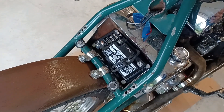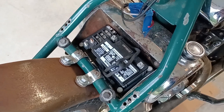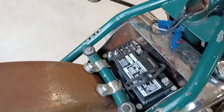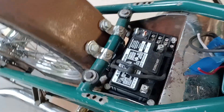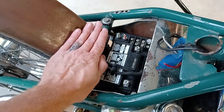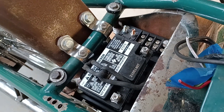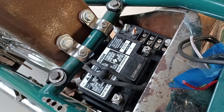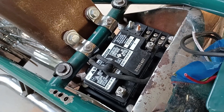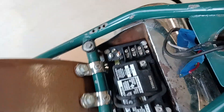I'm going to start with the bike itself because I got a lot of this stuff already bolted in. I 3D printed a battery tray that fits inside this old chopper oil tank, and it's holding the battery. This is a kick-only bike, not an electric start, so I was able to use a really small battery. It's an ETZ7S — an Autozone or Advanced Auto special — and similar numbers are all about the same. It should be plenty for running kick-only.